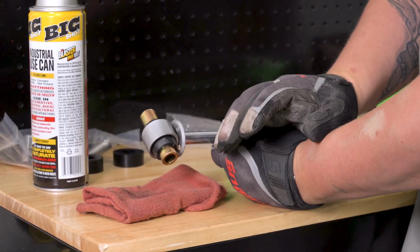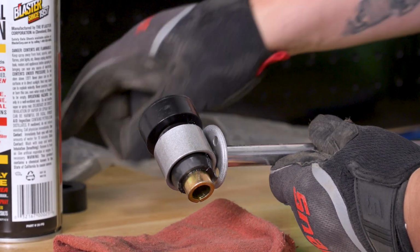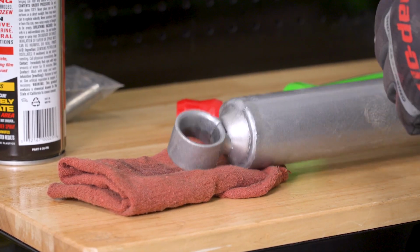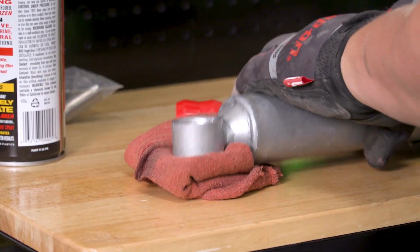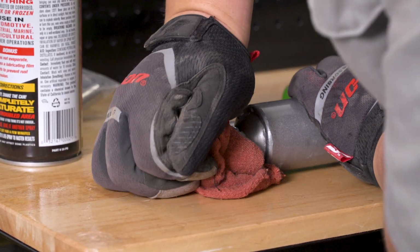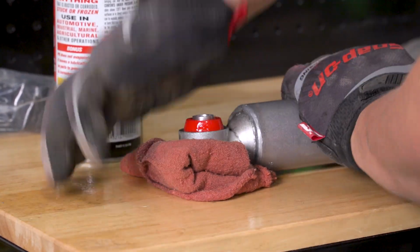Now you'll notice on the top of our shock, the top mount, our metal tube's a little long. Well, that's to fill in the gap that's in the frame by adding these polyurethane washers on the outside. Now just go ahead and install the one that goes on the bottom and we can get these shocks into our Jeep. Now using the same process, a little bit of penetrating oil. There you have it. Now our shock is ready for install.